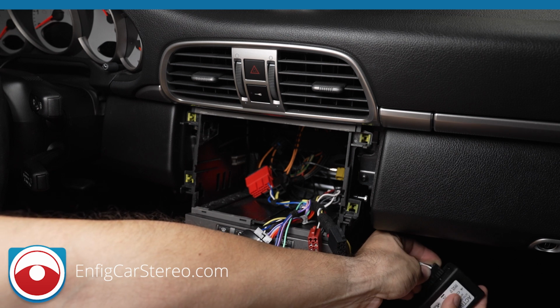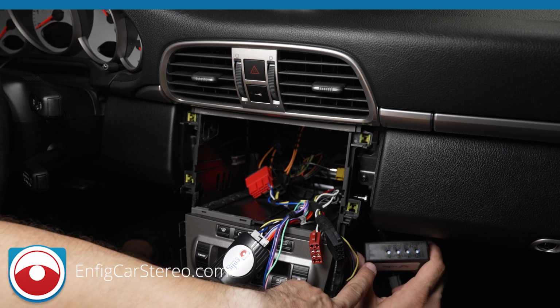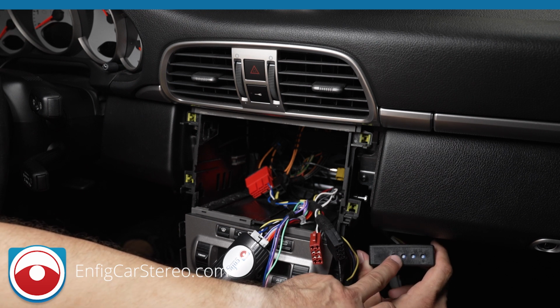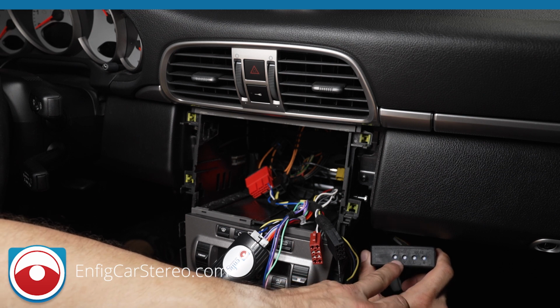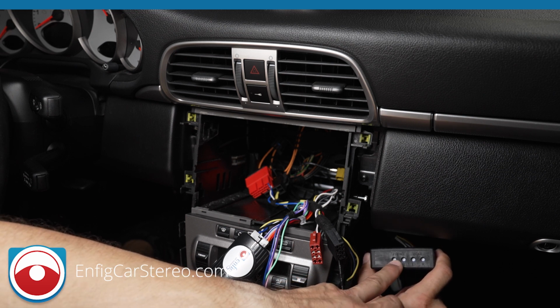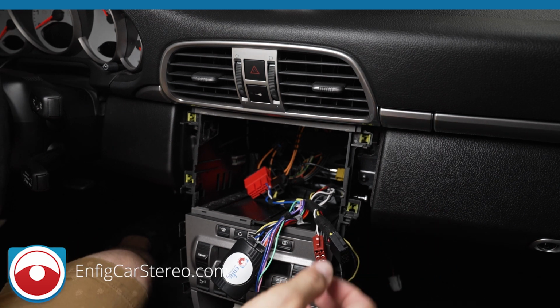Oh, also, these interfaces only adjust the front channel. So if you look at the high-low box, it has 4. I do not have any of the ones that have 2 in stock, so we're using a 4-banger for this. Doesn't matter, I'm only going to use the front. But on the ones that you get, you most likely will have 2. And if you have 4, that just means we ran out of the 2. This is one of the few cars that only has 2 channels.